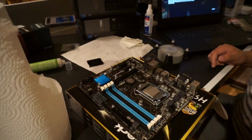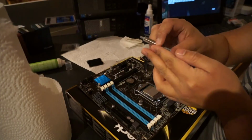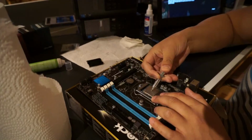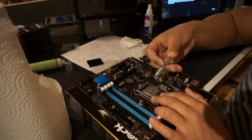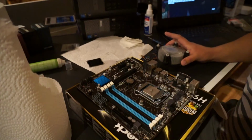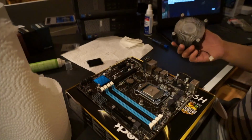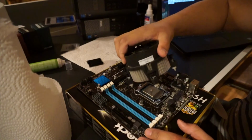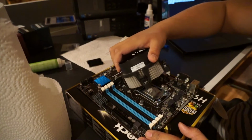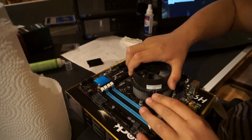It just makes a little bit of noise, but it's a lot easier for you to deal with. So when you're applying thermal paste, a lot of people have different application methods. You can just do a pea in the middle, just like that. You can do a line. There's been a video by Linus Tech Tips, a really popular tech channel, that has showed you that you can do either way. It's all the same. So you line up these spots here, another side, and when they're lined up, you'll be good to go.